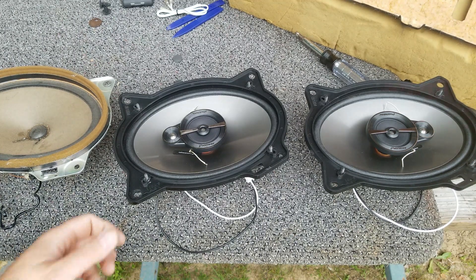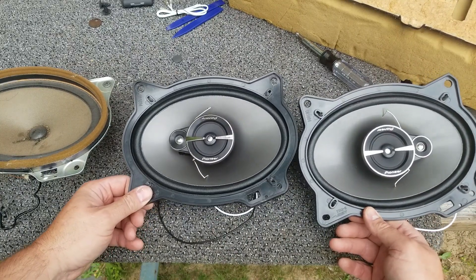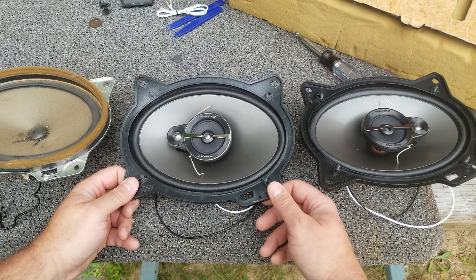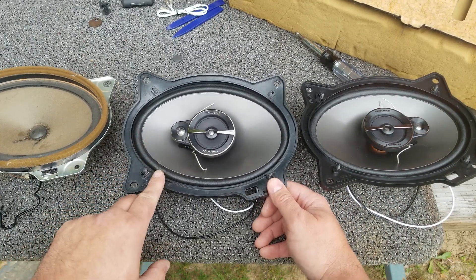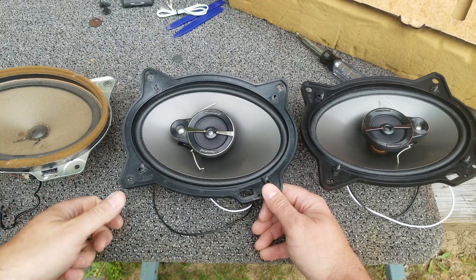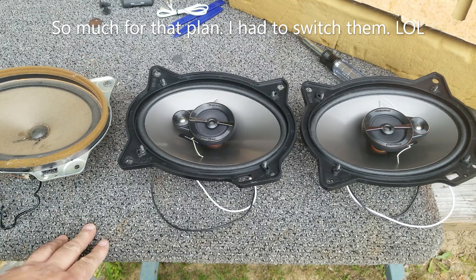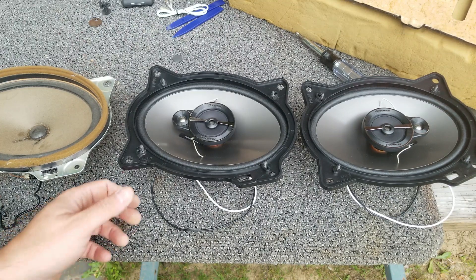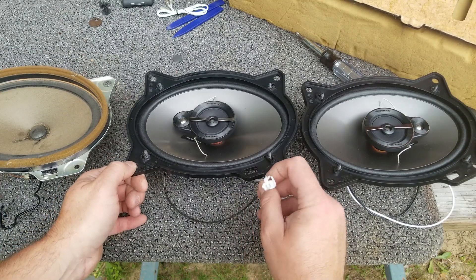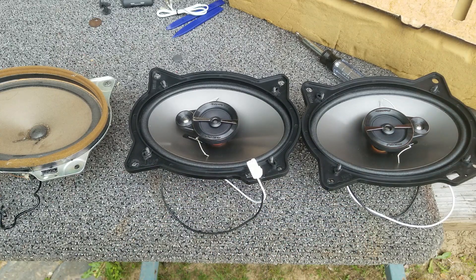I have the speakers turned so that the tweeters are opposing one another. You can see it says Pioneer top and bottom — I just feel like there should be something that signifies one's a left and one's a right. I'm going to put them in so this one will be on the passenger side, with this ear-piercing tweeter blowing right into the C-pillar rather than killing whoever's sitting in the back seat. I wound up switching them for left and right because of the way the wires have to run — this will make my wires the right length. I'll plug this in so I don't lose it, then tuck this wire down underneath.